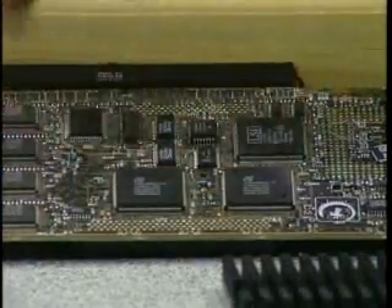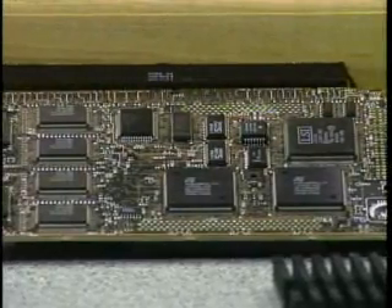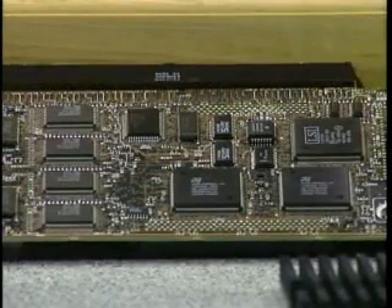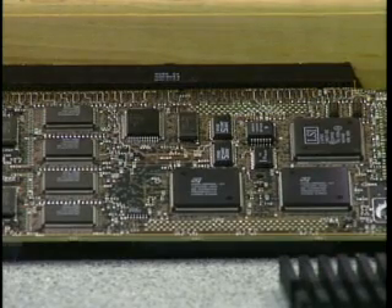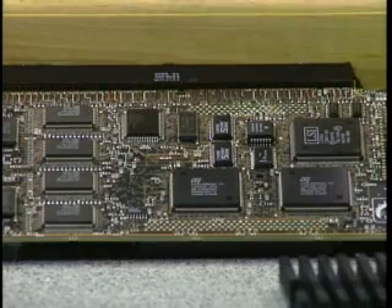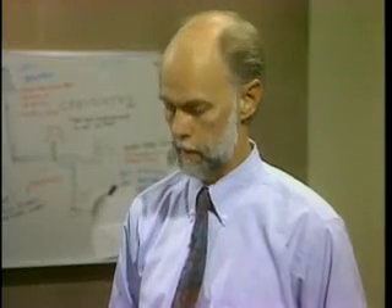We can take this off here, plus the four address buffers. What we've done with that is designing our own chipset for the Pentium — we make use of all the performance and features that are in there. The biggest one is to make sure, as Steven said, to keep the Pentium processor full. And we do a 128-bit path to memory, along with things like looking at algorithms to understand what the next instruction cycle may be.